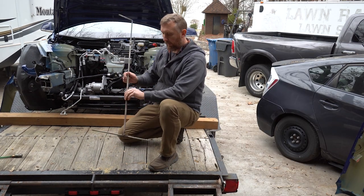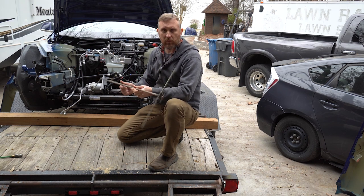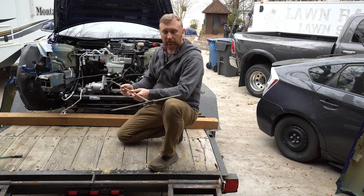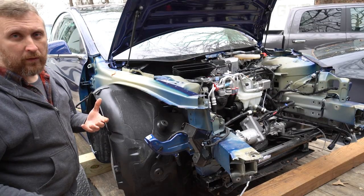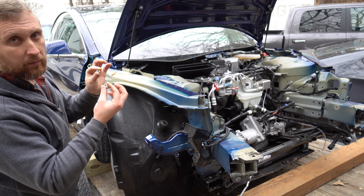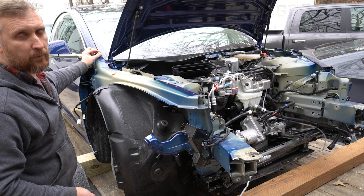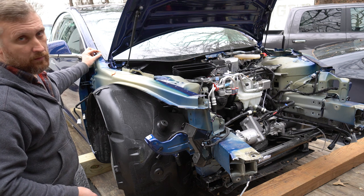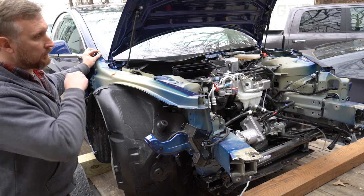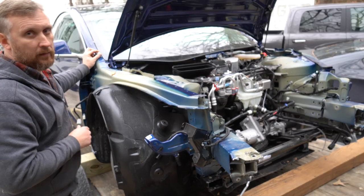To get my measurements I have this wonder tool that I made a few years ago — it's not the best looking but it definitely does the job. Since I'm working alone, I'm gonna take two nuts — exactly the same nuts — and use a glue gun to temporarily glue them to these corners. That way I can just put my tool into this nut and easily align the other side.